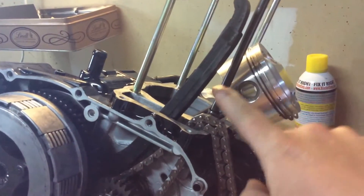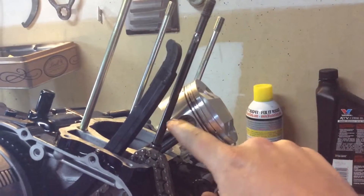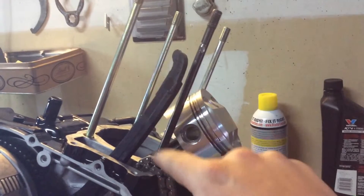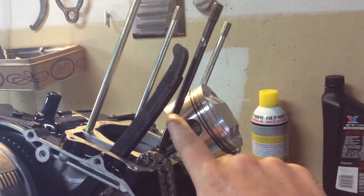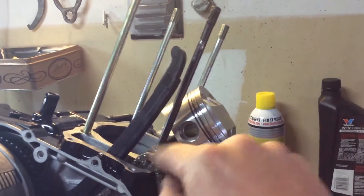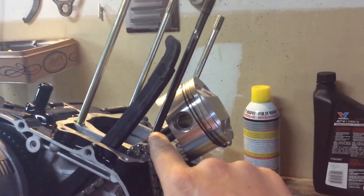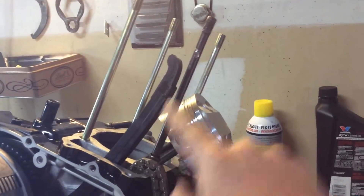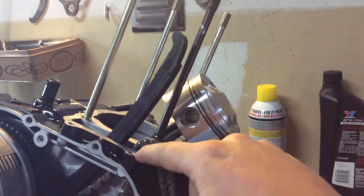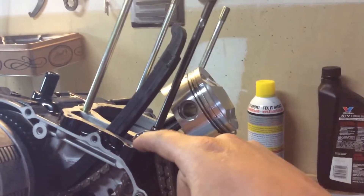As you can see, I replaced all my studs - I guess I didn't replace this one, they were out of stock. I ordered like the last three and they are different. I thought they were all four the same but I remember they had different part numbers. I can't remember which ones go where - I think the taller ones go in the front. All four new studs, all four new washers, all four new nuts, and I've got to dig out and find these two side bolts, two little six millimeter with eight millimeter heads on them.